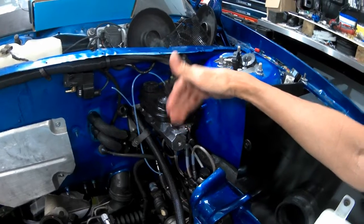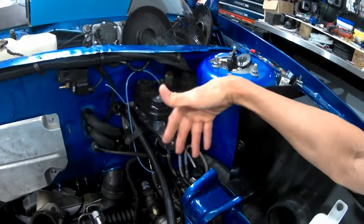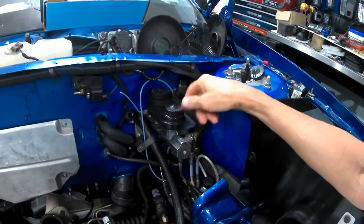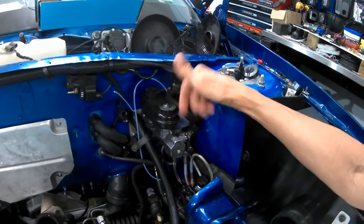So there isn't a front or rear — it's front-rear, front-rear, if that makes any sense. Really it's the proportioning valve that divides how much pressure goes to the rear and how much to the front.